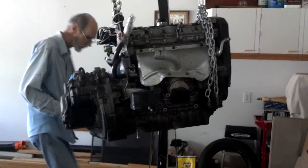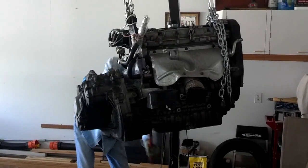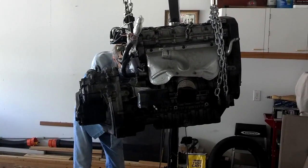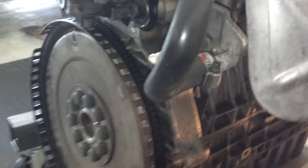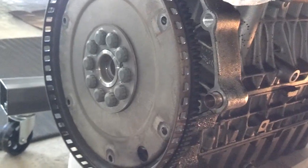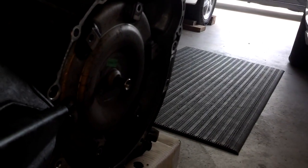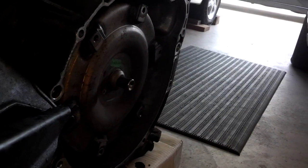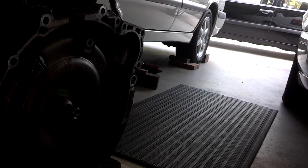We're taking a couple of bolts out of the lower side of the transmission so when we set it on the ground we can go ahead and finish unbolting the transmission and start taking the flywheel off. We pulled the 10 bolts from around the transmission but left three in around the top, and we got the flywheel bolts loose — they were T50s, six of those. Then we pulled those last three bolts out of the transmission, and Ken made a dolly the right height so the transmission just rolled right away from the engine.